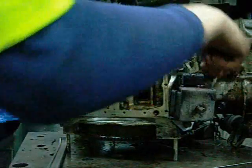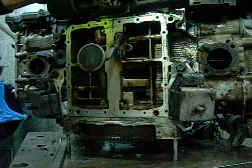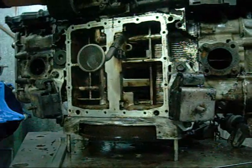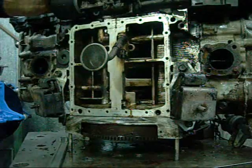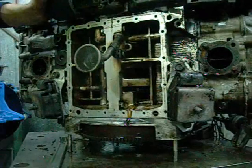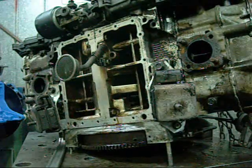Yeah, that's the stuck exhaust valve right there. Puking all the water I put in it out. I washed the whole thing down with degreaser with no covers or anything on it, so the cylinders were full of water. That's the only one that puked when it wasn't supposed to. Oh! Yeah, you get the idea. She ain't happy.